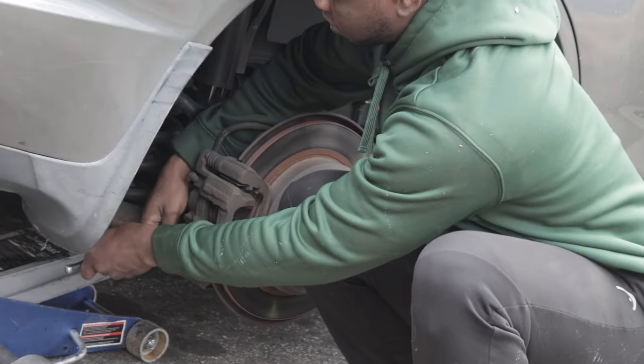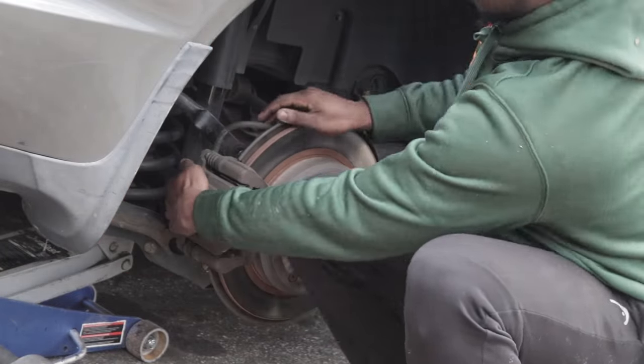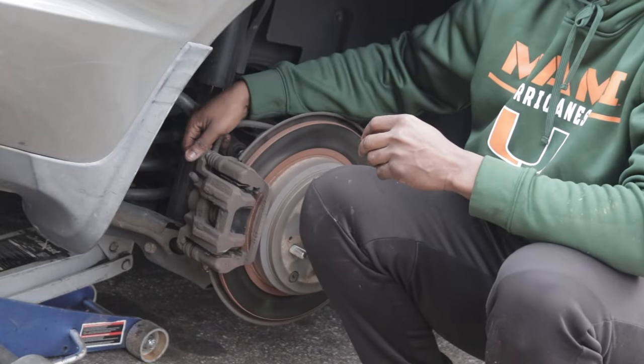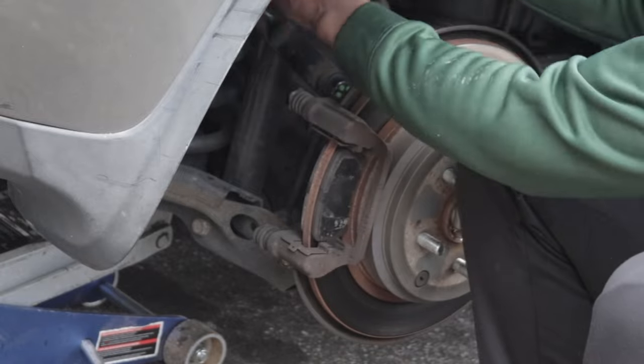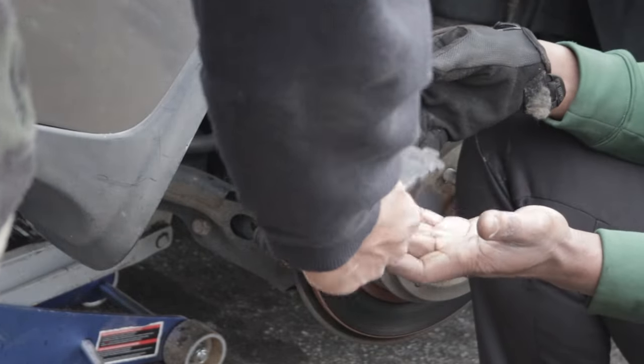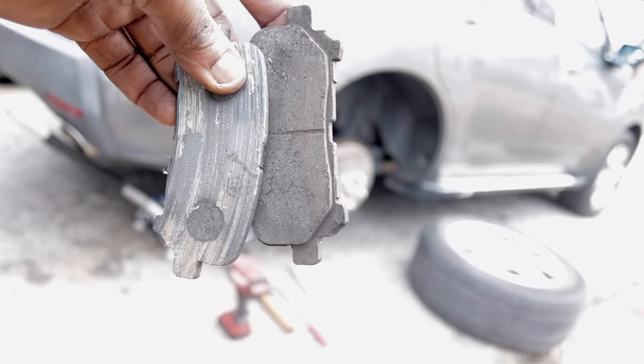This had been going on about a week, and as soon as I pulled the wheel off I could see exactly what it was. His brake pads were at zero, so every time he pressed on his brakes, instead of pads it would be metal slowing down the rotor, causing that screeching grinding he was feeling.